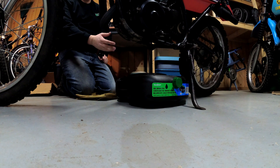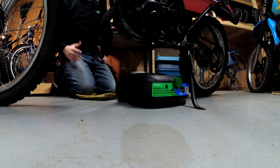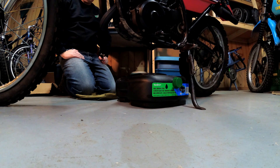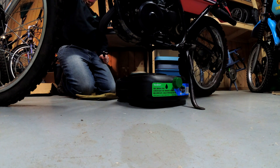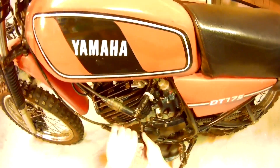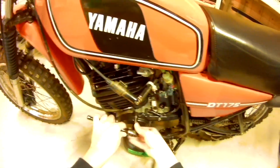This is probably drained enough — it seems like there wasn't much oil in there to begin with. That probably explains why it was shifting poorly. There's still a decent stream coming out, but it's not huge. The first thing I'm going to do while the oil is draining is take off this side cover, as that's where the seal is behind. I'll start by taking all these bolts off.